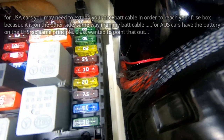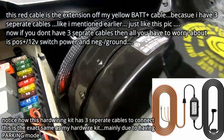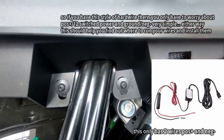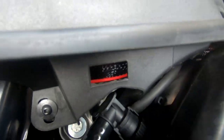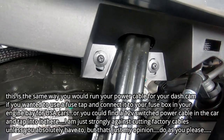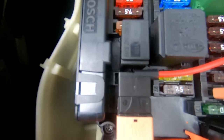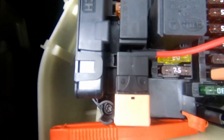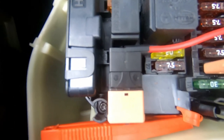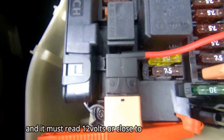If you're in America, your fuse box is going to be on the other side, but it's still the same principle. You just run your cabling through here and tuck it all under here — as you can see, the red cable there. I've run it all along in here. Then get it to your fuse box and use fuse number 36 — it may be different, but either way just test for a 12 volt switched power source. While the car is off, make sure that fuse does not work, and when the car is on, the fuse should work. That is your 12 volt switched power source.